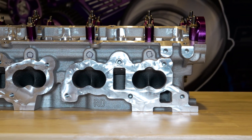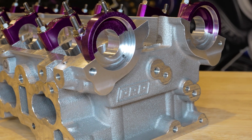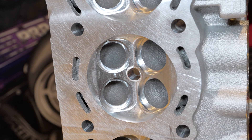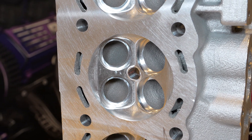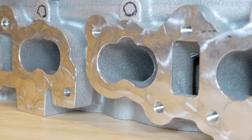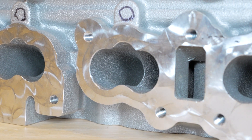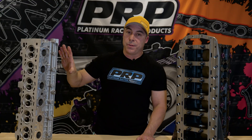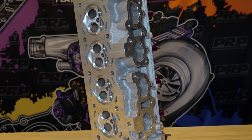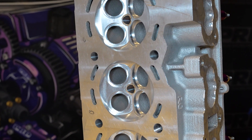There are four levels of heads that will come as completely built finished heads, or you can buy them in pieces — castings, unfinished, unmachined. As you can see, this cylinder head has all the combustion chambers finished. We've done all our seats — the main bores for the valve seats. The ports stay standard, basically the casting for an OEM or street application. The ports flow heaps. It all comes down to standard sizing valves for the OEM version, or you go one millimeter over for the street application.